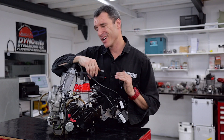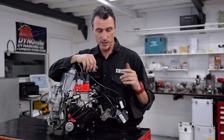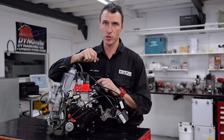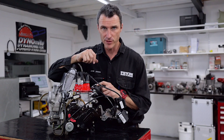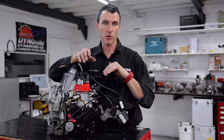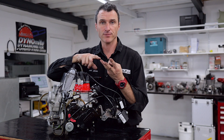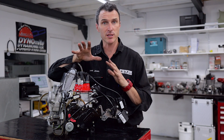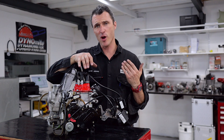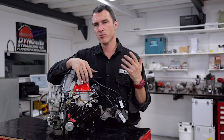Another great feature — and the one I like the most, because it was a bit of an Achilles heel of the Senior Max engine — is the new power valve assembly. We've got an electronically controlled, what they call the RAVE cylinder, and that controls the pressure to the power valve, so that magically at 7,500 RPM that power valve snaps open. Whereas before it used to creep open a little bit, depending on your gear ratio, jetting, throttle position, and kart setup — all those things had a variation on the loading on the motor, and that would actually make the power valve open and give the engine what they call a bog off the corners.